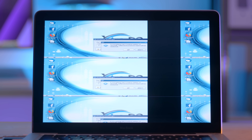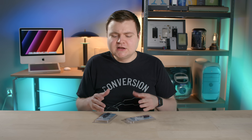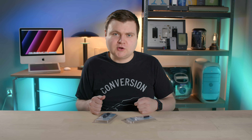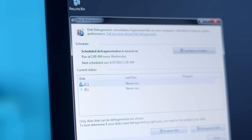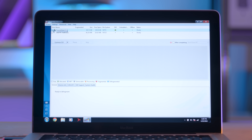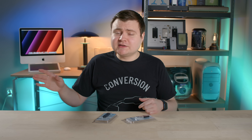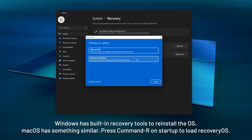Overall, pretty basic. I have no problems with how these things were advertised — the claims aren't false, at least in the two videos on their website. But like I was hinting at, this is kind of a temporary band-aid fix. So what are some more long-term solutions to fixing a slow PC? If the physical hard drive is still working but running slow, you may need to defrag the hard disk. I've had better luck using Auslogics' defragging tool compared to the built-in Windows tool, and I actually just used Auslogics' on a friend's PC about a week ago and it's running much faster. And sometimes you just need to do a good old-fashioned reformat and reinstall and start fresh.